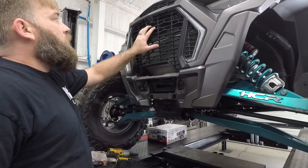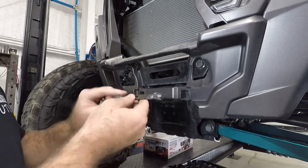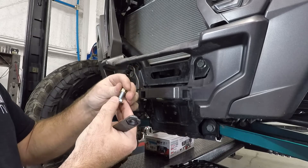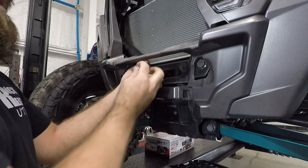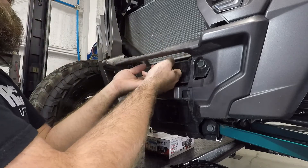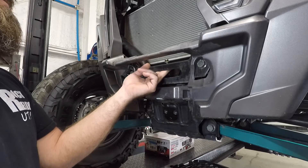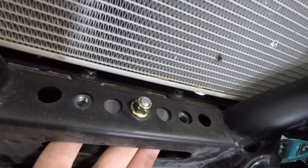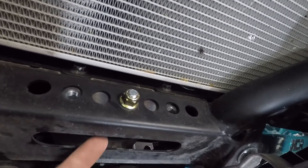Next up, we can get the grill out of the way. You can put it in and out after the bumper is on the machine. Next, grab the backing plate that has the two nuts welded in it, along with the carriage bolt and the nylock nut. You are going to put this backing plate up into the frame, then use that carriage bolt and stick it up through the plate along with the frame. Whenever you tighten this nut down, don't make it all the way tight — just snug it, because you might need to move the plate around a little bit to get your bolts to line up with those welded-in nuts.